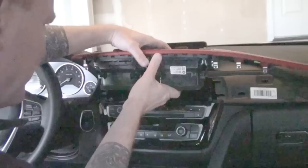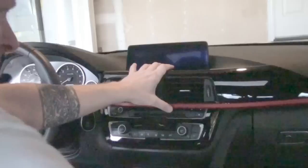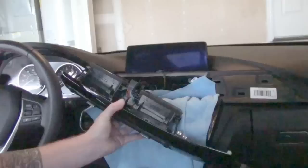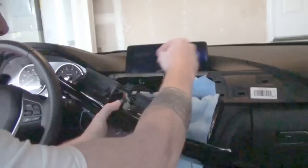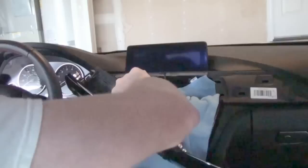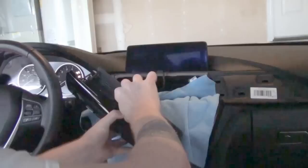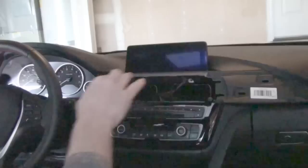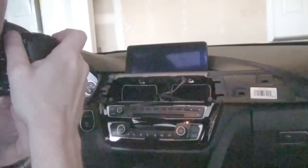I really feel like this piece is in the way, and I'd like to remove it if possible. I'm going to pause the video and go get a towel to protect my controls. So you can see I've got a towel in place to help protect the stereo controls. This cable is out — I grabbed it with both hands, one piece here and another here, and pulled firmly. It was in pretty tight, so be careful. There are two cables connecting this trim piece, and the second one I backed right out as well, applying even but careful pressure. The trim piece is now out and free.